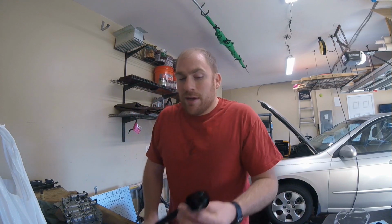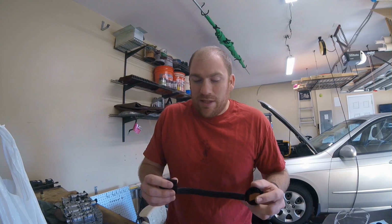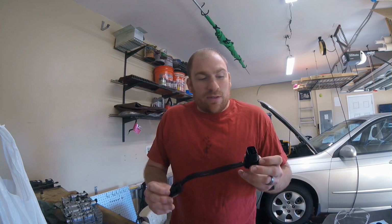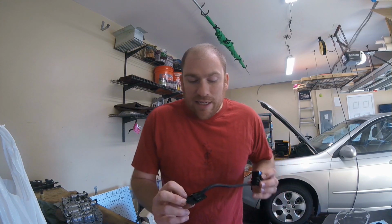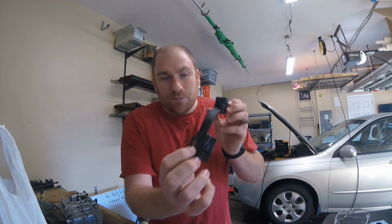So it's a great video describing the burnt up wire harnesses. I had to undertake this project here, and it's the exact same type of thing. I just wanted to point out one thing that was unique: since I had the fluid temperature sensor code for that transmission, I kept looking for where the actual sensor is. And it's actually part of the wire harness there. It's this little resistor, a little thermistor right here.